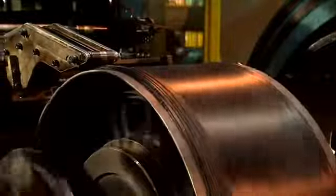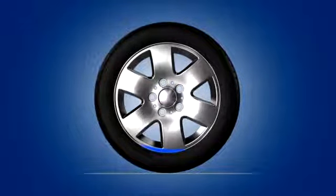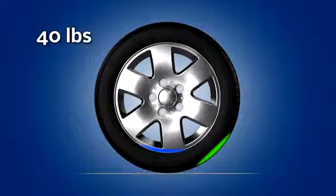However, wheels and tires are not manufactured in a perfect world, and even though they are both built to extremely tight tolerances, weight imbalances are unavoidable. Nearly every wheel has some type of imbalance or heavy spot, noted in blue on the illustration, and most every tire has an imbalance, noted in green on the illustration. These weight imbalances are typically very minimal in size. When you consider that a typical passenger car tire mounted on an alloy wheel weighs about 40 pounds, it's amazing that the total amount of imbalance is typically no more than two ounces, or about one-third of one percent.